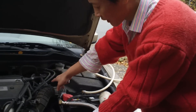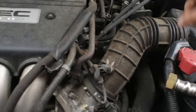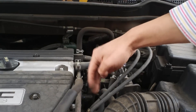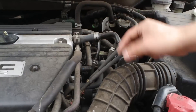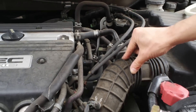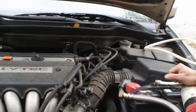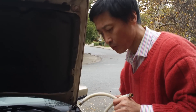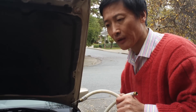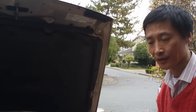The first possible problem is a leak on the intake mixture. This could have a leak, or other parts could have a leak. When there's a leak, the computer inside the car thinks there's a change in the mixture, so the engine RPM will change — usually going up. There are two different ways to find the leak: one is to use the sensors in the car, and one is to use your own senses.